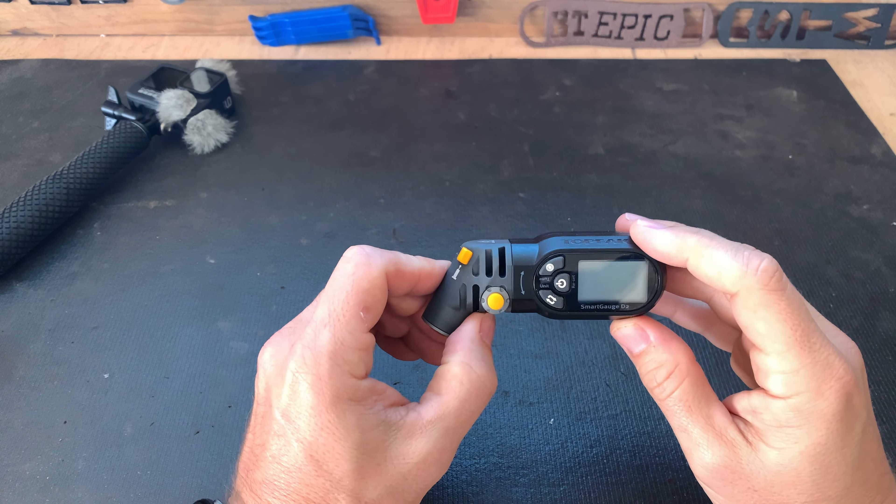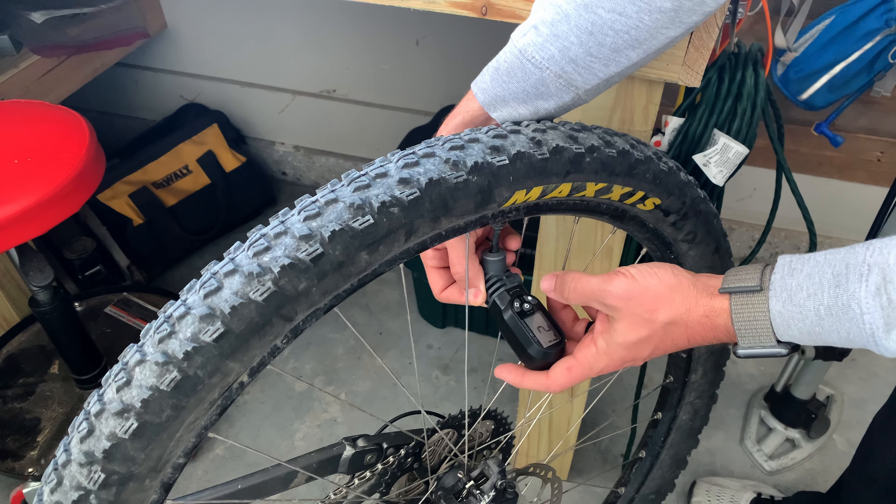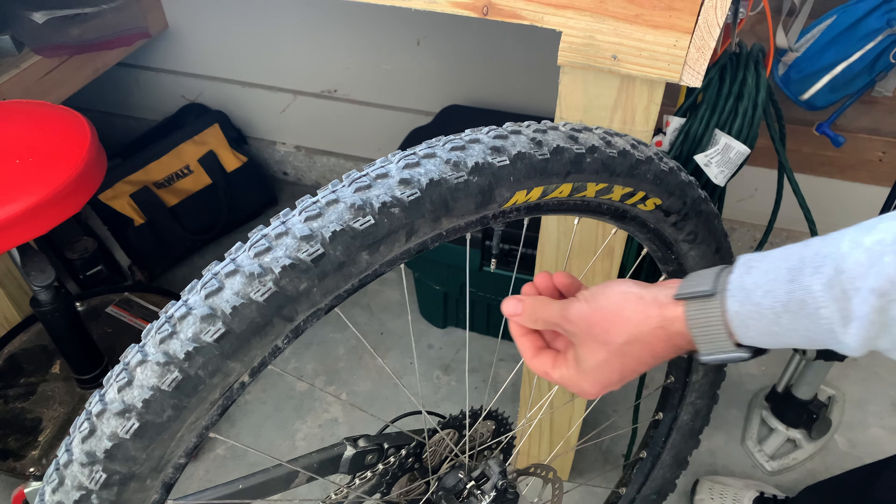Let's go ahead and remove the valve cap and open up the valve itself — now I'm ready to test it. Putting it on there, it shows I'm at 27 PSI, which is way higher than what I want. I'll hit the tune button and then press the little button on the side. You'll see it drop down in PSI, and when you let go it gives you the actual reading of the tire. I want to be right around 22 to 23. There we go — that's good. I like to hit the tune button again just to confirm 23 as the final reading, and then you're good to take it off, close up your tire, and you know exactly what pressure your tire is actually running.